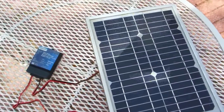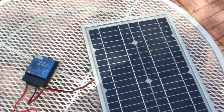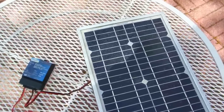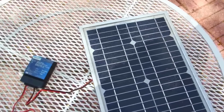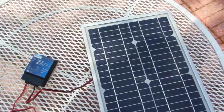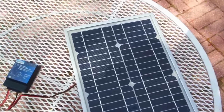Nobody's going to test something for like 15 years, but that battery in my Jeep has been in there 15 years, and it was the cheapest battery they sold at AutoZone. It had a 6-month replacement guarantee, 1 year limited warranty, and typically you're lucky if you get 2 or 3 years out of that kind of quality battery, but it's been in there 15 years. The one thing I did different was I used a little solar panel, a 1 watt one, not as strong as this, and just kept it plugged into the cigarette lighter. That's enough to keep it from getting screwed up.